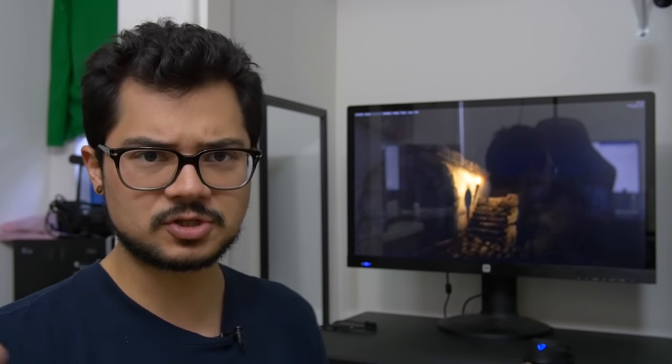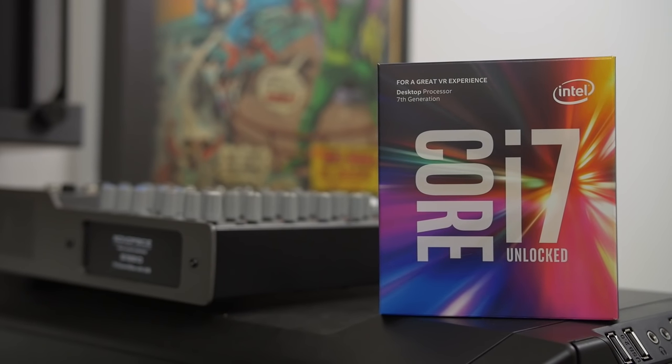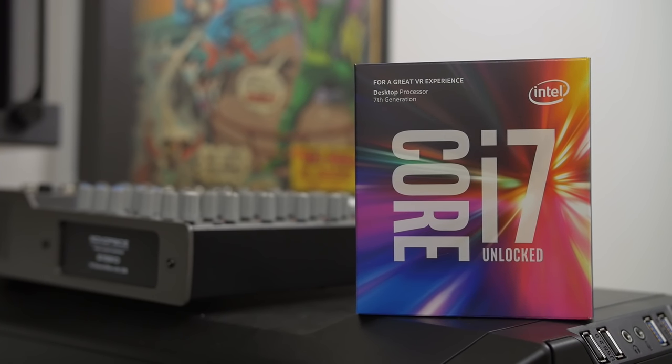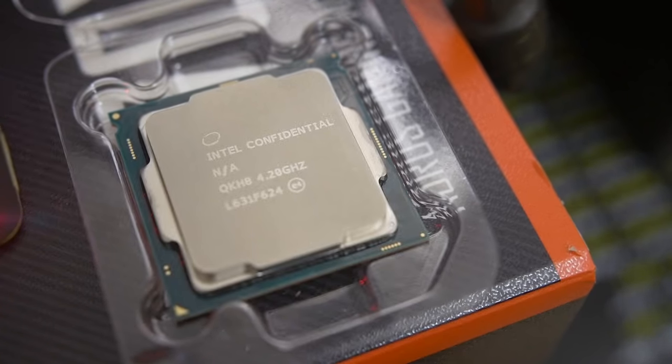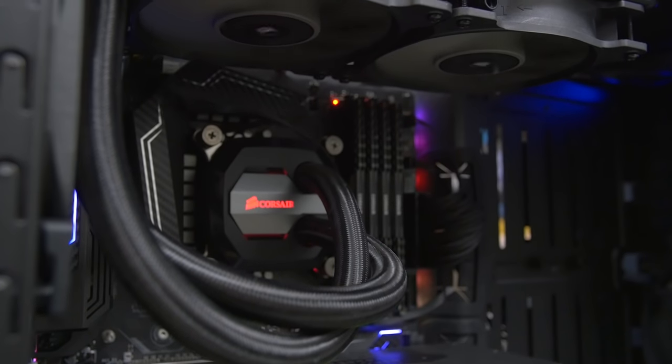I already have all the hardware set up here. As far as the processor, we've got the Core i7-7700K — Kaby Lake architecture, Intel's seventh-generation core — overclocked quite heavily to 5 GHz at just over 1.4 volts, running stable after stress testing. I wanted to dial in an aggressive overclock because at moderate to low speeds we wouldn't see as much variable difference between thermals from test to test.